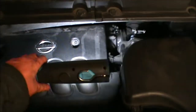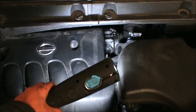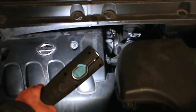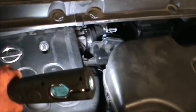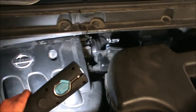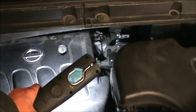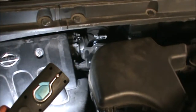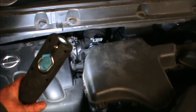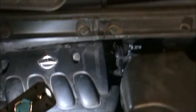There's a valve that sits right by the throttle body with two Phillips screws. If you apply a little bit of grease on the O-ring, you can push it in and then tighten the Phillips screws. You then have to fit this airbox here. That airbox goes onto the intake hose, and the other side of it goes into the top of the manifold. And then this side, you just put a clamp on it with your pliers, and the other side you tighten the 10 mil screw bolt there. Be careful not to over tighten things.